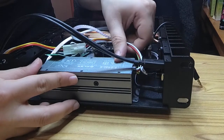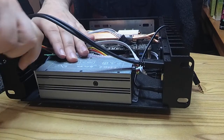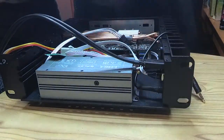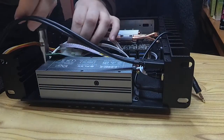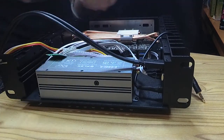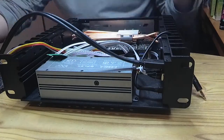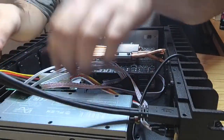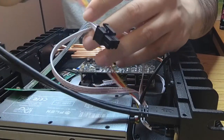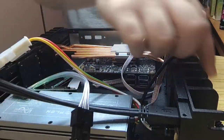So the kettle lead plugs into this power supply, and then this power supply has a little 19-volt output that plugs into the Librem Mini's motherboard on the outside of the case. So it's a really simple way of doing it, and it gives me the option to use a standard power supply lead instead of having to use the one that came with the Librem Mini. And now the process is basically a load of cable management, just plugging things in and trying things out and seeing which combination of cable layouts works the best.